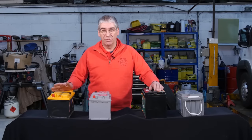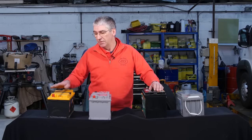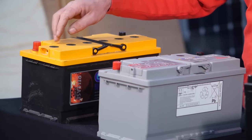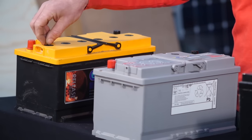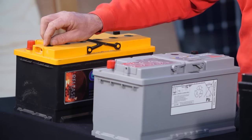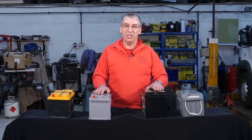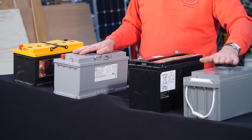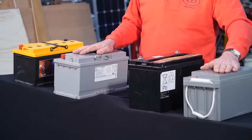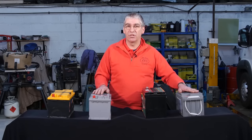If you're doing a lot of wild camping off-grid, then a battery-to-battery charger may well be a good addition to your setup. You can have multiple batteries. Typically motorhomes come from the manufacturers with just one battery fitted. UK motorhomes tend to be the lead-acid types; some will use AGMs. Very few British vans come with gel. A lot of the German and Continental vans come with gel.